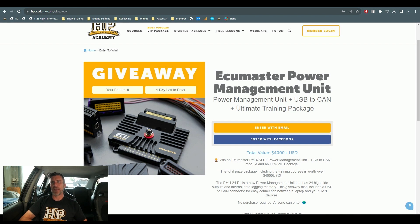Now if I'm talking in a foreign language to some of you and you've never heard of a power distribution module — to go back a step — in simple terms it's basically a way of eliminating your relays and fuses, which are obviously an essential part of the power delivery circuit for pretty much everything in your car. Instead we're doing this with solid state electronics. The benefit is we're very flexible on how we set up fusing limits and current limits for all channels, and how the different inputs and outputs are actually switched. We can switch them via a direct wired input via a switch, which is the conventional way, but these days we're seeing more people go across to CAN switch pads — a 15-key CAN switch pad to control so many functions of the car — and to wire these up it's just a simple four-wire connection: CAN high, CAN low, power and earth. It really, really dramatically simplifies the wiring.